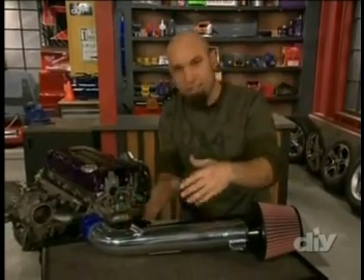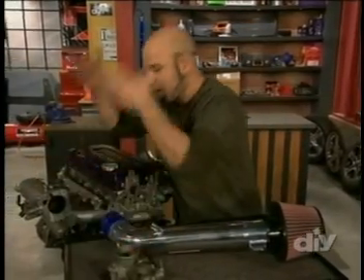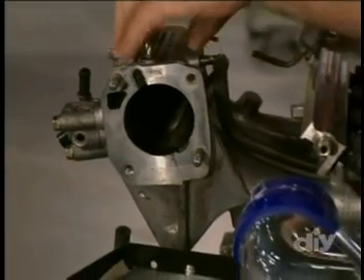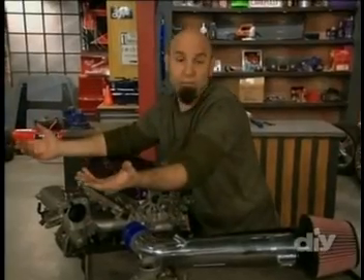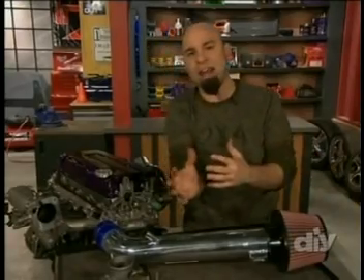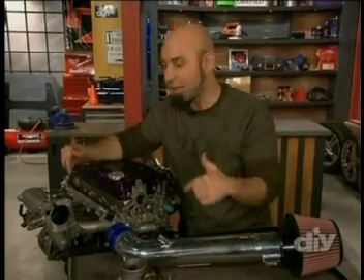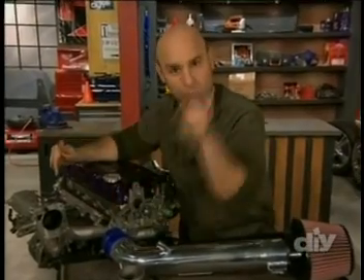How does this one big flow of air get distributed into all the cylinders? The intake manifold. When you step on the gas and that butterfly opens, all the air gets sucked into this chamber called the plenum, and then it divides down these four runners into the cylinders. You can have a huge filter on here pulling in all kinds of air, but if you have a restrictive intake manifold, it's not going to do you much good. And with all the mods on this Integra's engine, I bet that's exactly what's happening. The cure? Get rid of the old one and put in a new one.